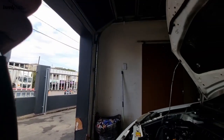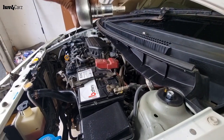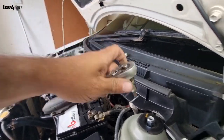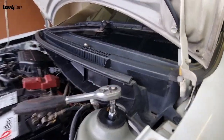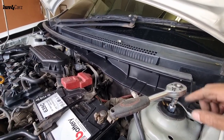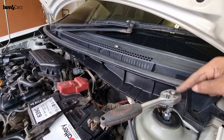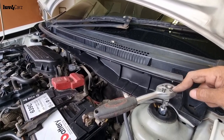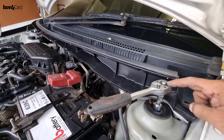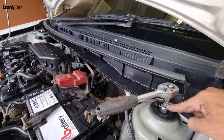The Allen that you have to use is a six millimeter Allen you'll have to use in there to hold it down, and then you'll have to use your 17 to tighten up this. But you don't turn this at all, you just have to hold the shock solid, or hold the shock still while using this Allen bolt here. If you turn this, you could mess up the shock, so hold tight, tie up here, don't move this.